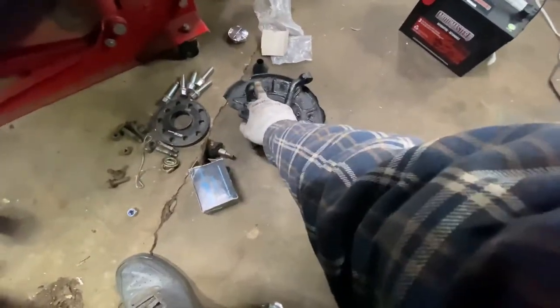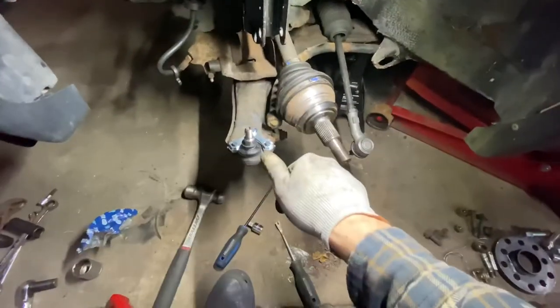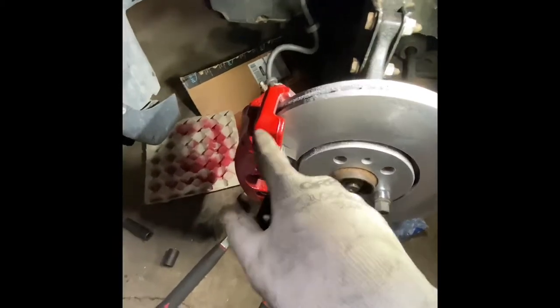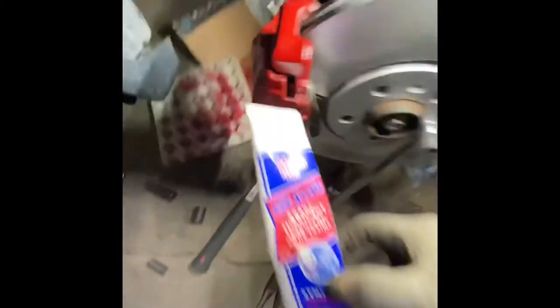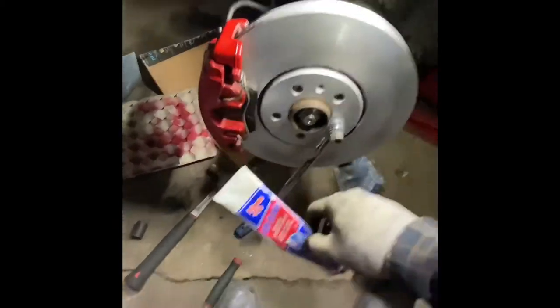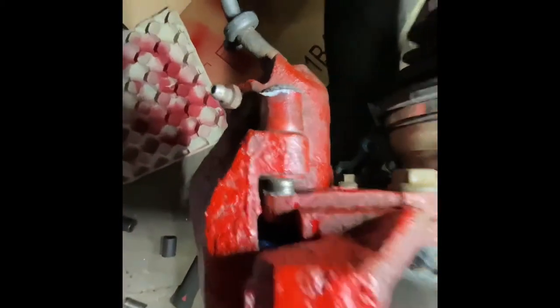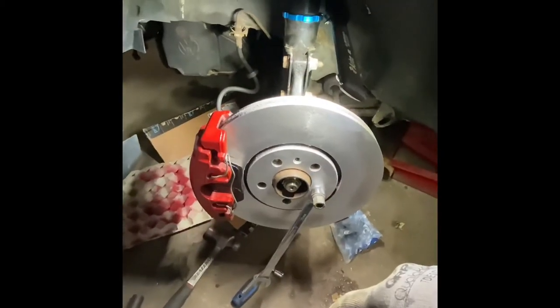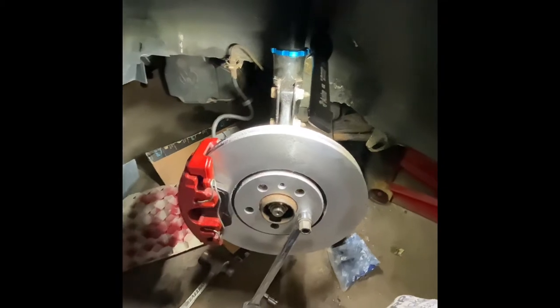So you grab your knuckle, the lower, and your new bolt. You're going to throw that on there, put the bolt on, put the axle in, and then that. Rotors on, caliper, caliper hanger. I lubed up the ends of the pads and the sliders with a synthetic brake lubricant, because you're not supposed to use the regular stuff on it — it seizes up and gets really hard. So that's all fixed up. Everything's in tight — tie rod, this, that, and the other. Throw the spacer on, throw the wheel on.